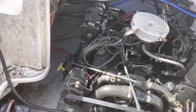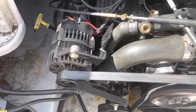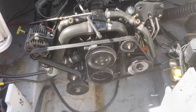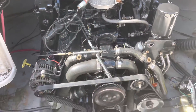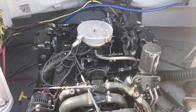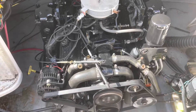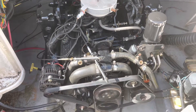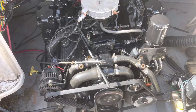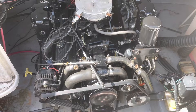The engine is now running normally. I let it idle and checked a few things. The battery is reading 13.1 to 13.2 volts and the alternator is working, but the gauge is not working — I still need to investigate that. I still have to connect up the throttle linkages and transmission linkages, which isn't very hard. I checked the timing again and it is dead on eight degrees before top dead center. Overall the engine is running great — I just need to tighten things up, connect the linkages, and figure out what's wrong with the gauges. Thanks for watching.